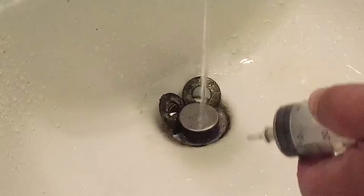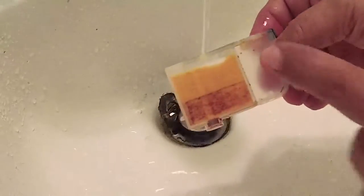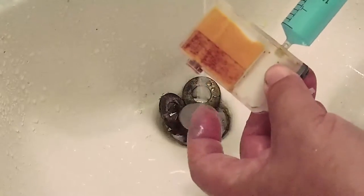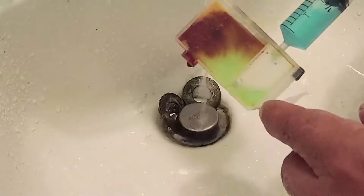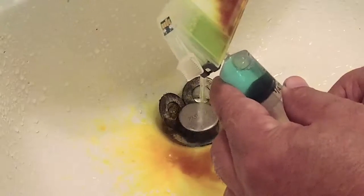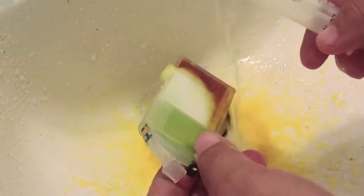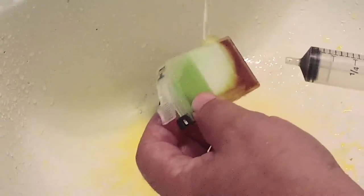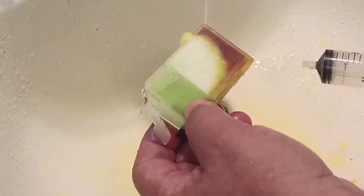Now I'll show you what to do with the yellow one. Here is one of those stubborn yellow cartridges. We're going to go ahead and not push any water through it — instead I'm going to directly inject some Windex through the cart. You can see it migrate its way through the sponge. We want to fill that sponge up as much as possible with Windex and let it sit for possibly an hour or two. You can already see how clean the sponge is becoming — it is almost devoid of yellow.